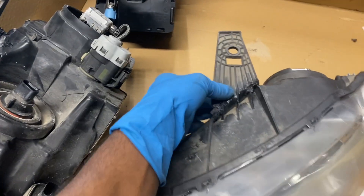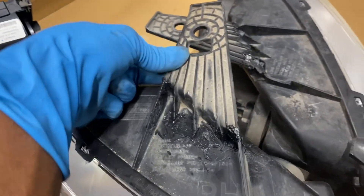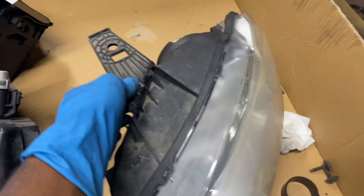Today we're going to finish up the process. The first thing we're doing is taking the windshield out because it's cracked and bad — we need to pull it now while the dashboard is out so we can get into the grooves where the glue holds the windshield to the body. We also did some plastic weld on the headlights, and it's actually very strong. Saved us a headlight.